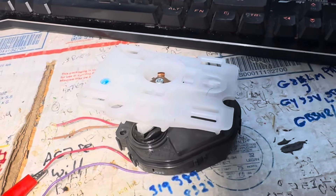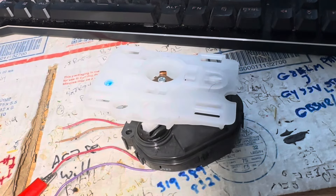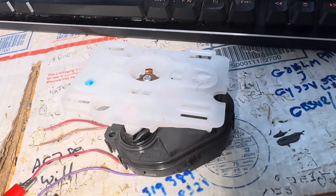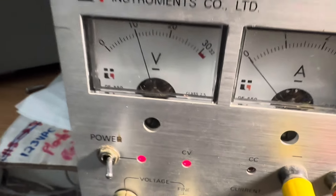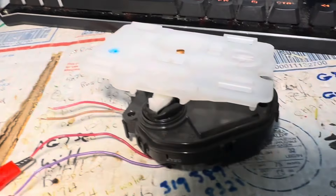Hello friends and followers. Here's how to test a Toyota side view mirror left or right assembly and motor for working. You can feed approximately 10 volts, probably 12, of DC into this thing and simply actuate the motors like this.